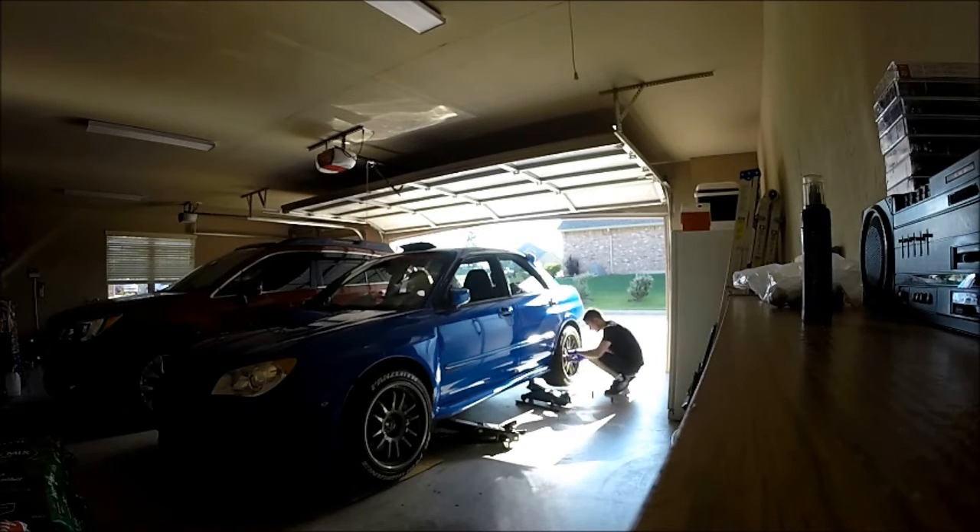While you're taking your tires off, not only do you want to check the tire and the wheel, but you can also check inside — your hub, your rotors, brake lines, bottoms of your coilovers or struts. While you have it like that, just go ahead and check all that. I did a quick look over.